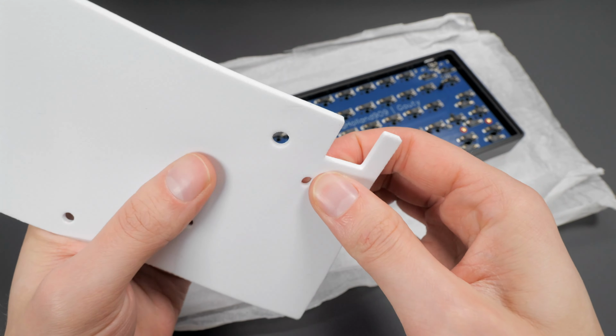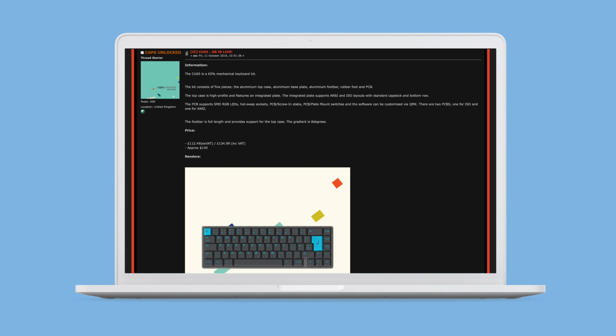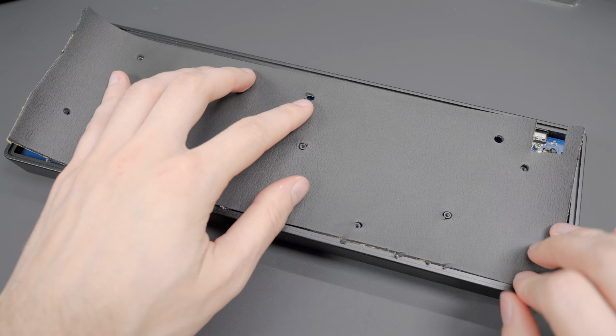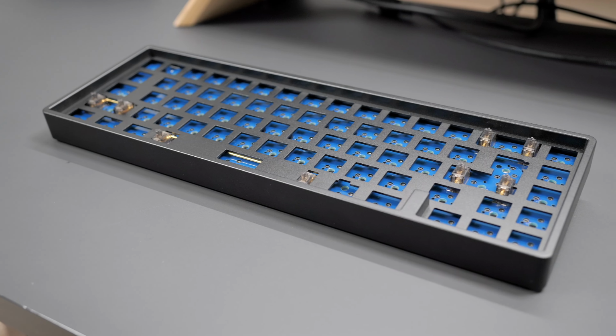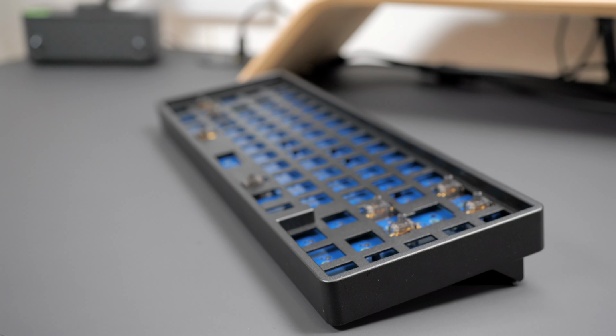It does look and feel like craft foam, and it's also worth noting that this keyboard was designed around 2 years ago, when adding foam wasn't as common as today. I did replace it with some denser neoprene foam that I had, which made a little difference, but given that there's no foam between the plate and PCB, the sound isn't that much dampened.